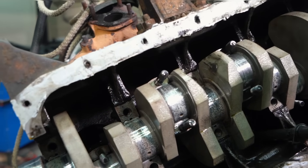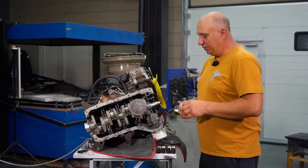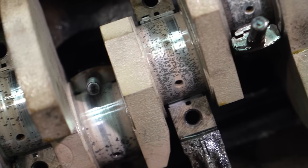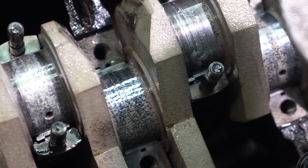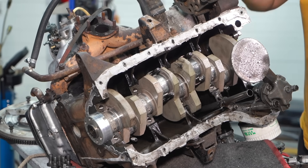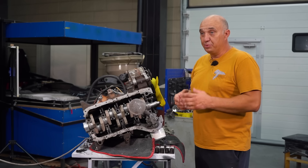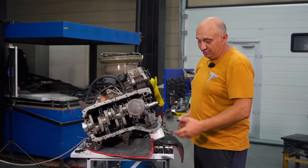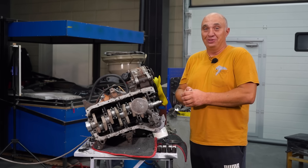So look here, guys — it's all looking very good. An aluminum crankshaft is a good thing: the engine is happy to rev and it operates quietly. But there is one issue. The coating we applied to the crank came into conflict with the bearing material, and they started eating away at each other so badly that a couple — or maybe three — of the journals are in horrible condition. They are chewed up. This might be the result of thermal expansion; we did leave a bit of clearance, but aluminum expands considerably. And so there's your reason. Those are the results — the engine was on the verge of seizing, and you can plainly see why that's the case. So this worked alright, but it didn't last long. Subscribe to catch future experiments, and catch you later.